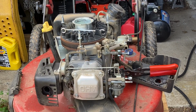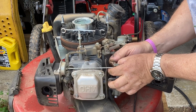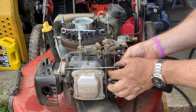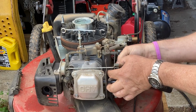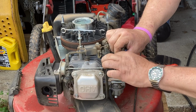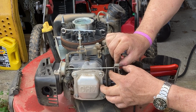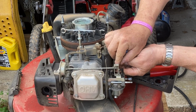That's done. Next thing, we'll do the throttle. So we'll stick the throttle in there. That's one. The throttle spring, which is sort of like a governor spring, keeps it from wonking around in there. Alright. Oh, I should have brought my glasses. My vision sucks lately, as far as seeing close. Alright, there's that spring. And there we go. Okay.